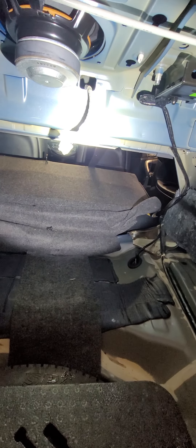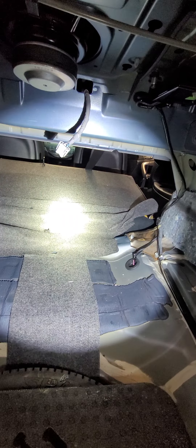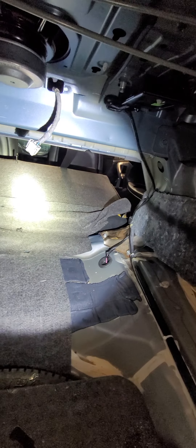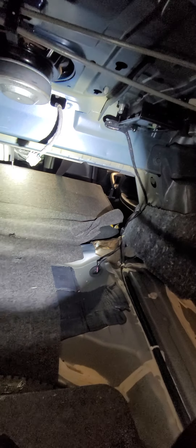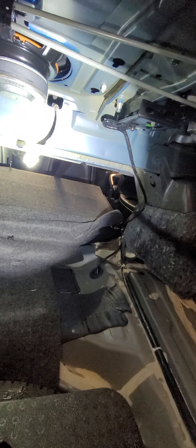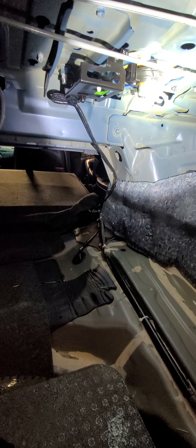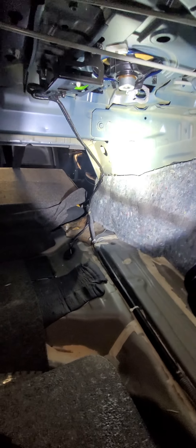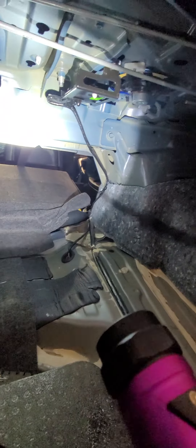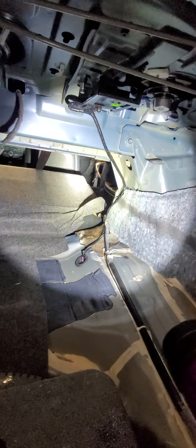There's the factory subwoofer, and there's the harness for it. I already know which wire is which, so my line-out converter is going to connect straight to that and I'll have a really good signal for my amplifier. It's not going to get a high or mid-range sound out of it — it's going to get low frequencies just like the subwoofer does, so I won't have to do very much fine-tuning on the frequencies for the subwoofer. Very easy way to do this. If you don't have a factory subwoofer, you'll have to go over to the speakers and connect into those, then play with your frequencies or get a crossover. So far so good — I'm kind of at a pause waiting on stuff to come in, but I'll do another video once we get cranking.